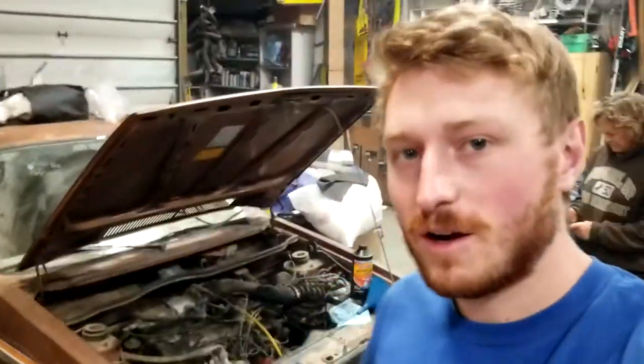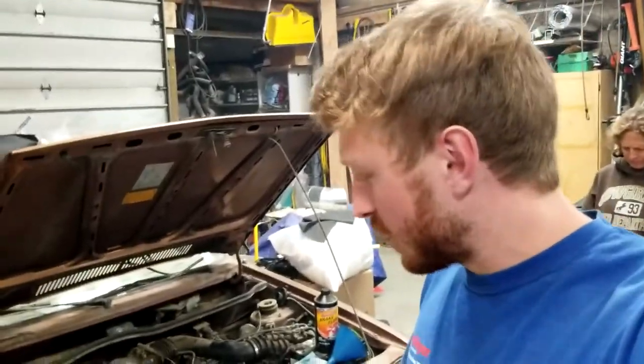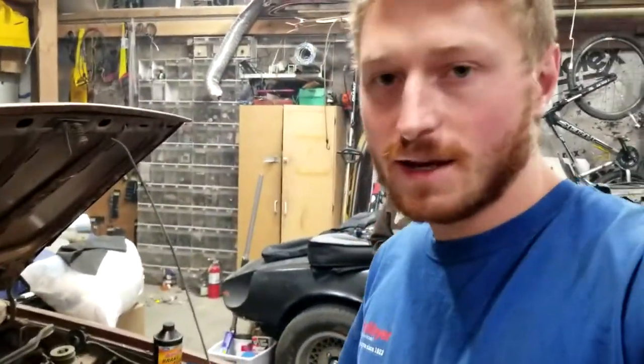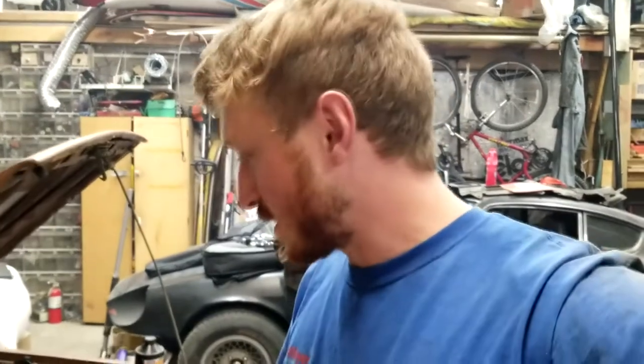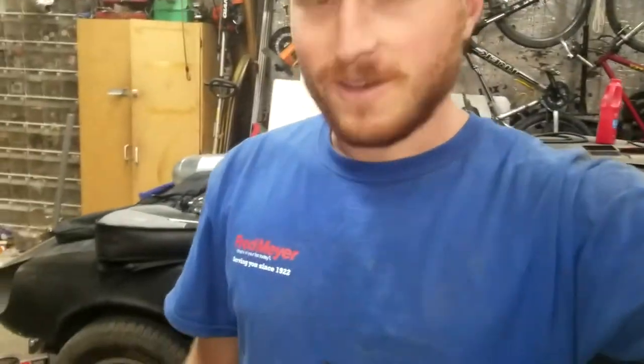Okay, so that's really exciting. The car is working again, running at least. I jacked it up and tried to put it in drive and reverse, and they both spin in the automatic, which is a good sign, but I can't stop them. That means the brakes don't work, which I already kind of knew. The brake pedal goes to the floor, the fluid is empty. So I guess the next adventure is to try to bleed those or see what's going on, and maybe we can take something for a quick test drive. So nothing's ever easy on this car, and the brake line's broken.